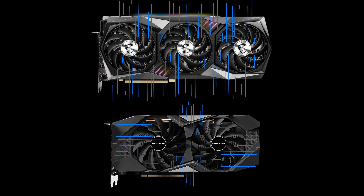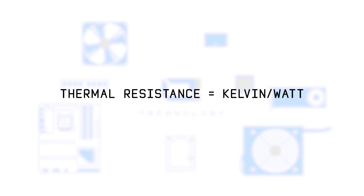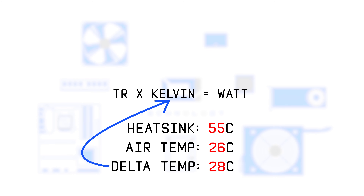As a direct result of recirculation, there is a higher intake temperature into the fans. On Nvidia's Founders Edition design, the airflow into the fans is almost purely cool air, which greatly increases the effectiveness of the heatsink. This is because heat flows from hot to cold, and the thermal resistance of a heatsink is measured in Kelvin per watt — the required temperature delta between the heatsink and the air per 1 watt of heat dissipation. Lower is better. The way to increase wattage dissipated is by lowering the temperature entering the heatsink, which increases the temperature delta in the equation.